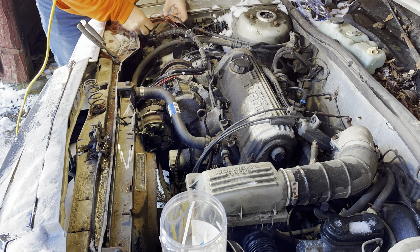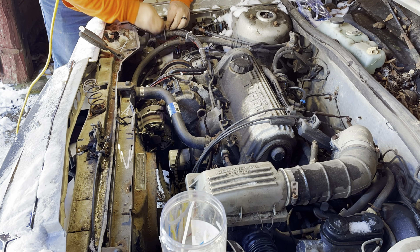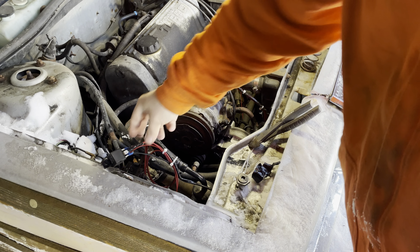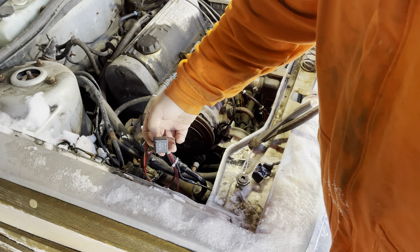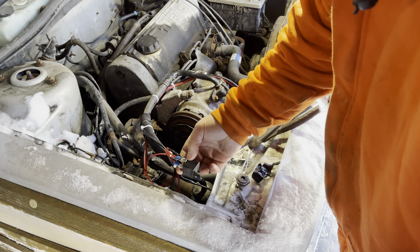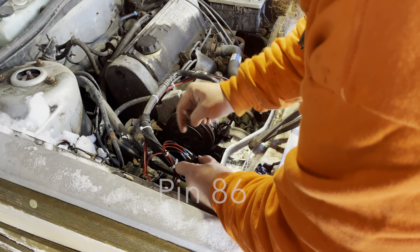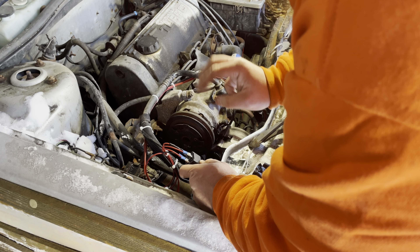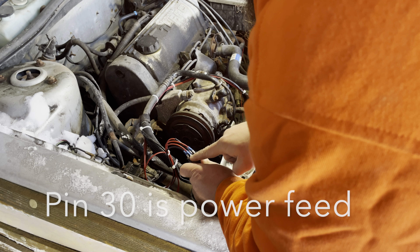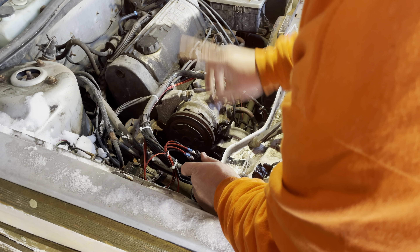My wife has always told me whenever I have an electrical problem, double check your grounds. About a third of the time she's right. When I came in and said the car just started overcharging, she said to double check the grounds. I was taking the alternator off and there's a ground lug directly on the alternator — I thought it was just a mounting bolt, but the alternators on turbo Dodges are isolated. There's a little 8mm bolt that is a grounding lug, and it was melted. That's probably why I fried the alternator.